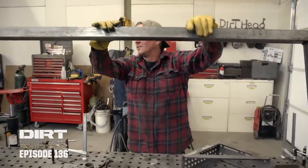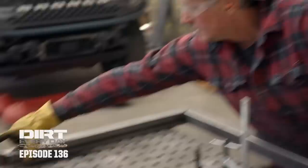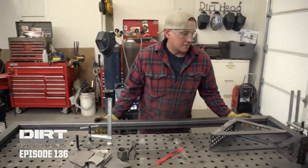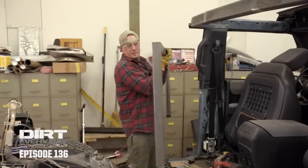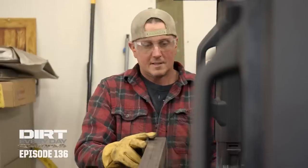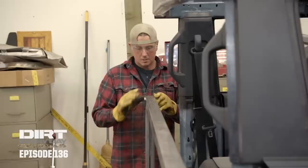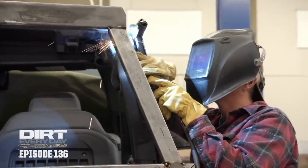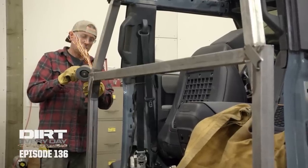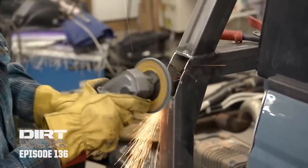I'm making the back of the cab for the Bronco — this is super basic style. This will be kind of at the back where the top will attach to, and then down here these little notches are going to go right into the rocker. So I'm going to go set it in there and hold it in place and see if I love it or if I hate it. I'm pretty sure I love it. That is ugly as all get out — this is hideous. How do I make this cool? I think what I'm going to do is weld these corners up a little better, and then cut a couple little reliefs in it so it matches better. That'll give it some shape. And then I'll try to cut an angle or a curve into it so at least a portion of it has the same body line as the cab. I can fix this.